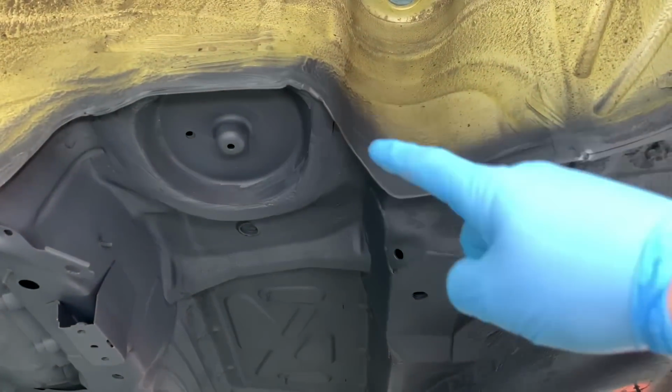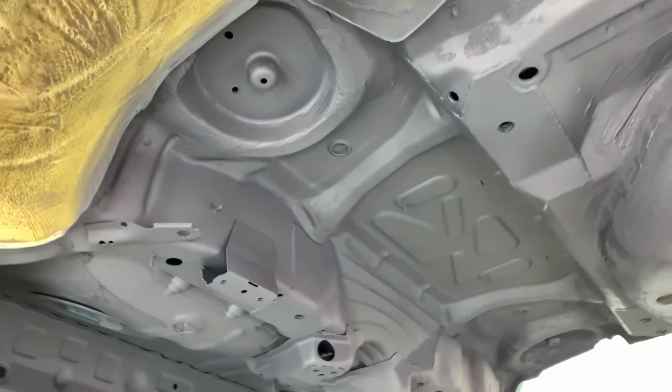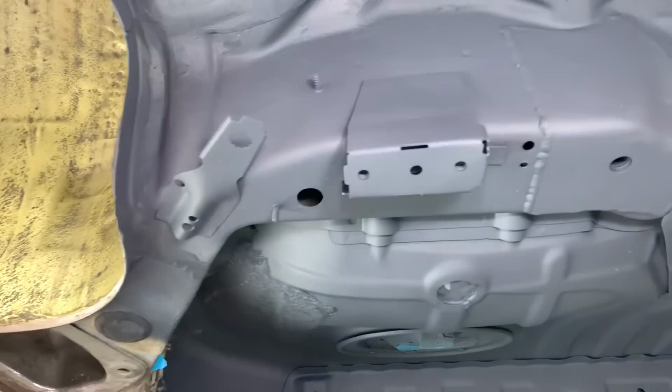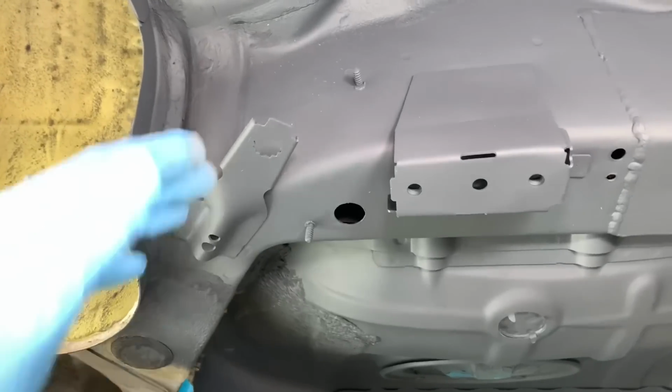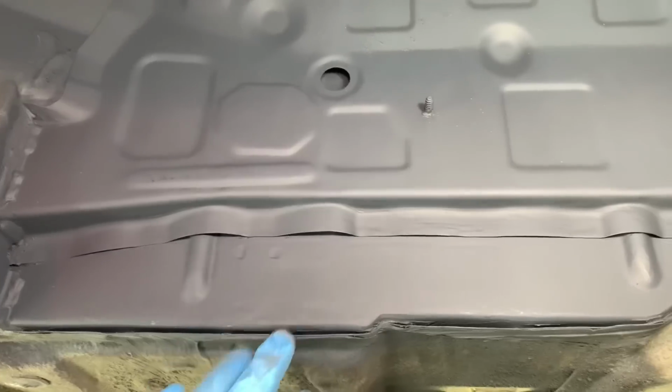It's been stitch welded down the side to connect the RACP to the wheel arch panel, which is a common thing we've been doing. Change over the brackets, get rid of those nasty BMW brackets and put on there the new Redish Motorsport brake pipe brackets and fuel tank strap brackets, both sides. Plus we've got to do the front ones as well, and just taking those ones off. Opening up the seams as well, something we're having to do more and more now.